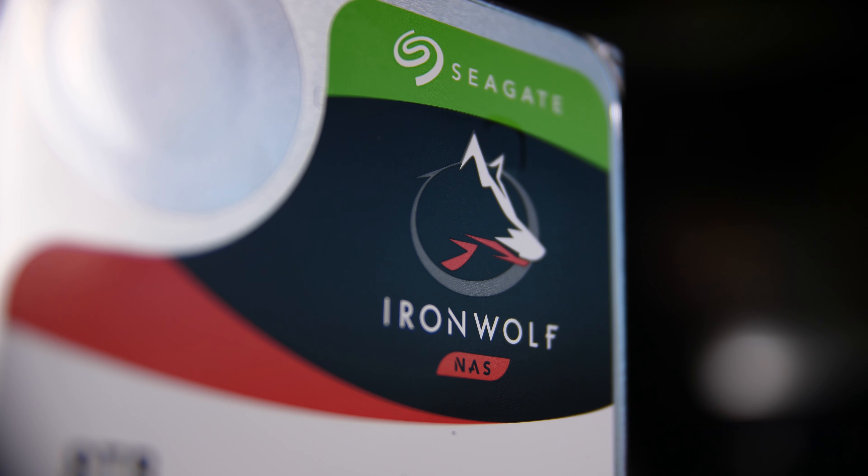The other 8TB drives already in the NAS — one of them is actually a Seagate Archive 8TB drive, which is a little bit on the slower side but has served me well. I'm going to swap all the data from that drive, which is my main work folder, onto the IronWolf array. Then I'll use that drive with the other 8TB drive in another RAID 1 array for personal and backup use. My FreeNAS NAS with two Seagate IronWolf 4TB drives is currently syncing a backup folder, but it's going to run out of space soon, so I'll likely be moving that to home use, virtual machines, and servers.